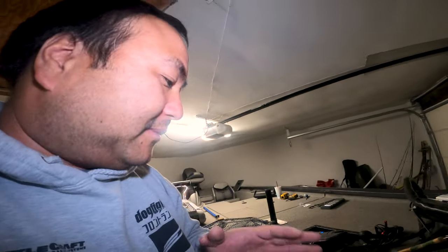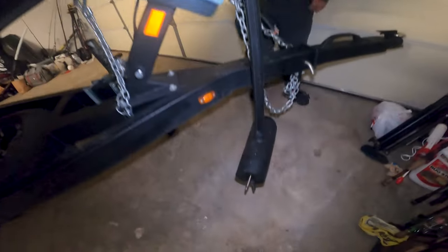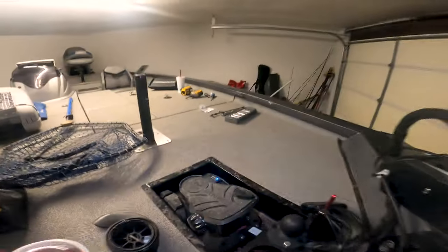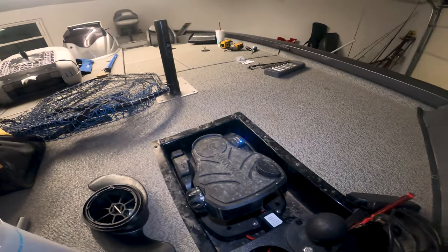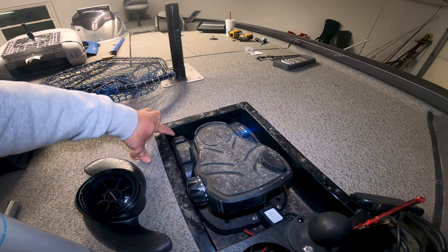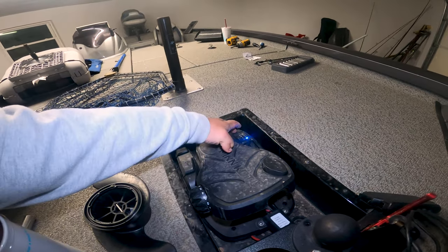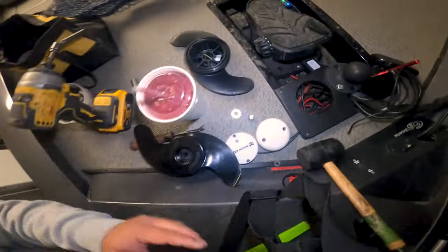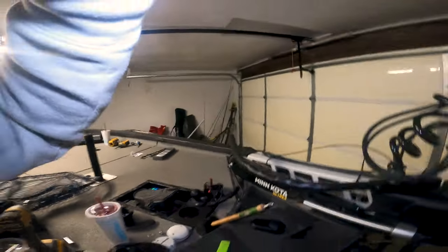Alright, so part of the tuning, we're going to tune the trolling motor while we're at it too. The Skeg doesn't matter exactly where it goes. The ultrasonic has to be straight, but the Skeg part can be off a little bit. So that's our plan. We got it facing down now. And as you can see, this Skeg is way off. It needs to be fixed. But we got the trolling motor powered on, and we got it on speed, say, speed 5. And I think if you press north, it's just going to go forward. Yeah. So that's the old tracks. Green light is on.